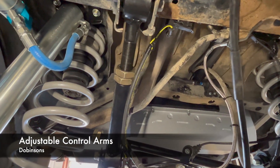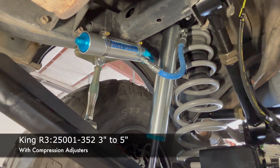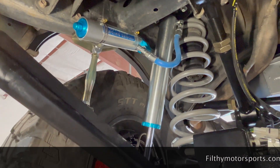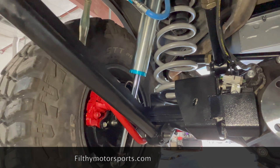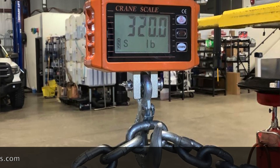We also used a brand-new locker actuator — that is the Slee locker actuator armor. You can see the adjustable Dobinsons, and then these are the King shocks which we got from Filthy Motorsports. They are set for three to five inches of lift and we had them tuned to our weight. I did weigh the axle assemblies before they were put on, so we have our sprung weight and our unsprung weight accounted for.